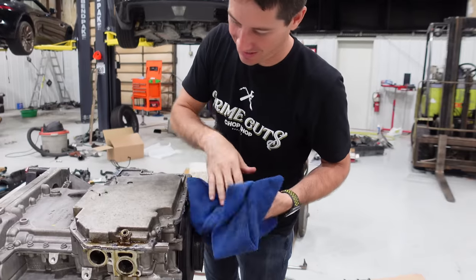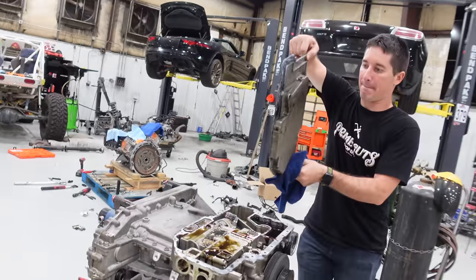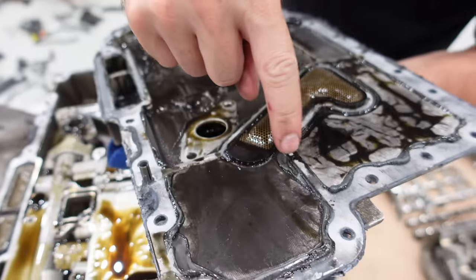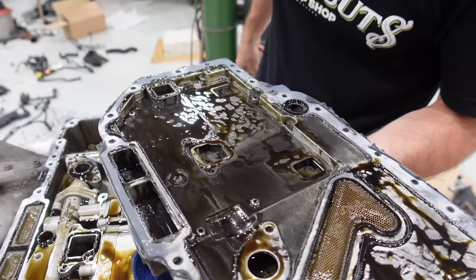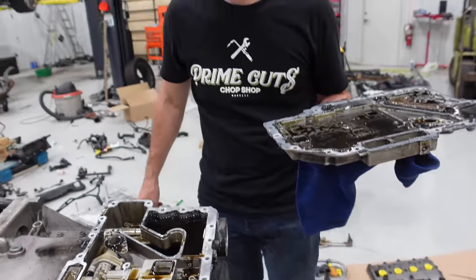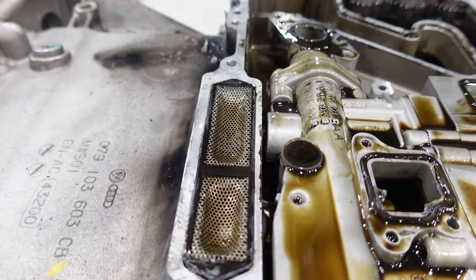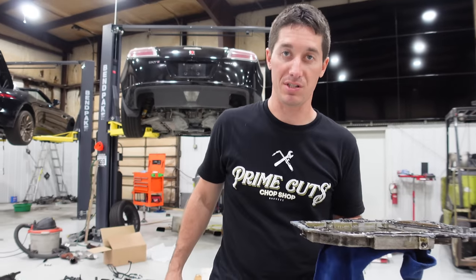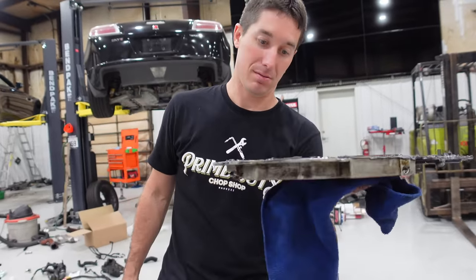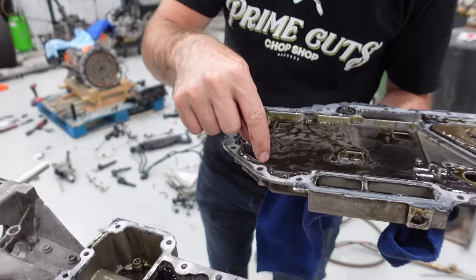How did this not grenade this engine? The pan's so hot, can't grab it. This is dangerous — if you ever do this to an engine it's a good way to put an end to it. There's so much RTV in there, I'm surprised it didn't kill the engine. This is exactly what's going on with all the Subarus — or GR86s — that are dying because they put so much RTV in there. It's clogging up and killing the engines in brand new BRZs. At least we all know about the famous case where Toyota came through and fixed that guy's car. But if you do this, it's on you — that's how you kill your engine. Just a thin little bead, run it around each one. That's all you got to do.